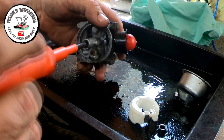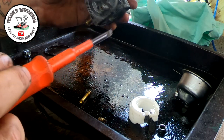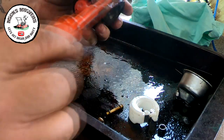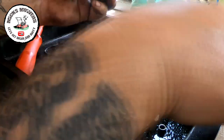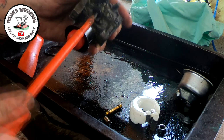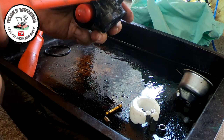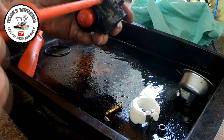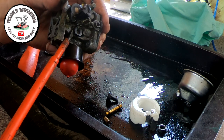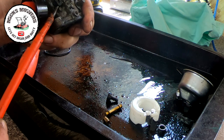I've got it on full zoom so hopefully you're going to get a nice close-up version of this carburetor. I'll take that out - they come out far too easily. We've got a slow idle jet to remove down here as well. I've given up counting these threads now - I just set about two and a half turns. You can always adjust it if need be. Take that out and you've got this slow idle jet just here. Take that out and put that to one side.